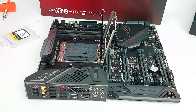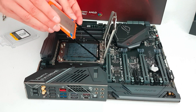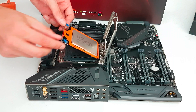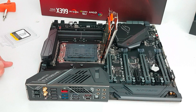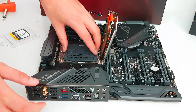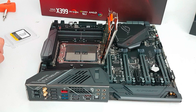The same way that we pulled it out we're going to insert the processor. So this is the 1950X — let me carefully insert it right now. We're inserting it, push down a little bit, and it can't go any deeper or further. That's the processor, and now we're going to remove the last lid — the cover for the pins. Over 4,000 pins, I might add. Just pull it upwards a little bit and it should come free. And there you have it — more than 4,000 pins.